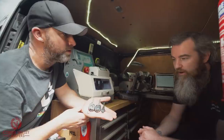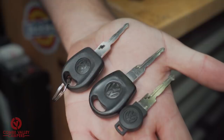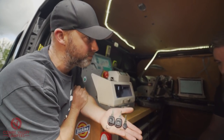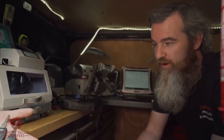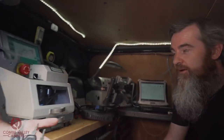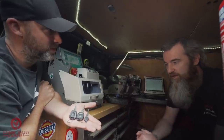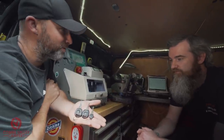The next process will be to get the engine code of the vehicle, put that into our tester, and then see if it can pull the pin code to allow us access to the immobiliser. You mentioned earlier that this is the point where we might laugh or cry, because sometimes the software doesn't pull the pin code from the vehicle — is that right? That's true. What we need to do is make sure we get optimum battery level, so we'll put a jump pack on the vehicle so the battery is nice and topped up, because that can interfere with key programming. So we need a good battery, retrieve the pin code, and hopefully we'll be able to program it — but yeah, sometimes it can be hit and miss. On this occasion we should be okay — let's get on with it.